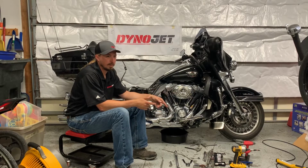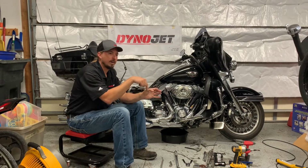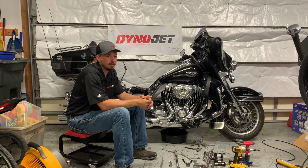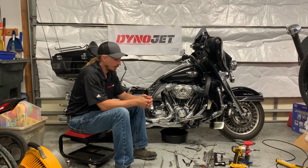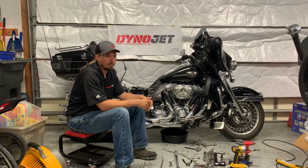For me, the piston ring expander tool is going to be really helpful because when we put the rings on the pistons themselves, you can roll them on and roll them around, but that does have the potential for scratching them or scratching the pistons. It's really just a matter of personal preference. Some people find that when they use the expander tools they're more likely to break the piston rings. That's certainly a risk, but I find that they work out pretty well, and whenever I've tried rolling piston rings on, I usually find that it ends up resulting in a scratch, so that's what I prefer.